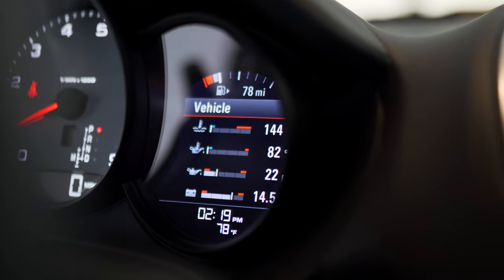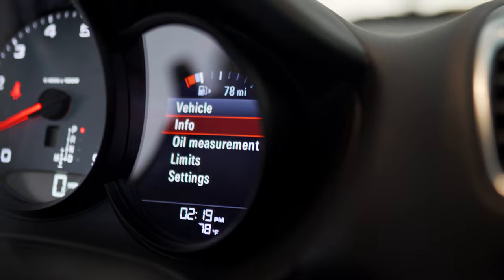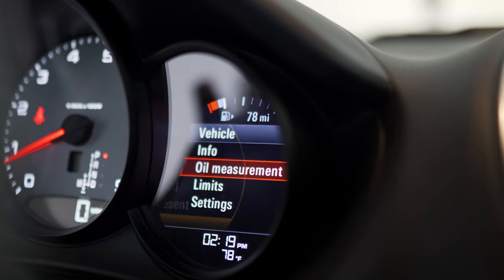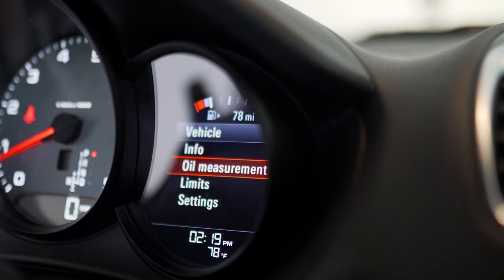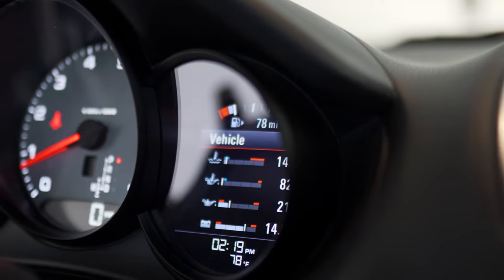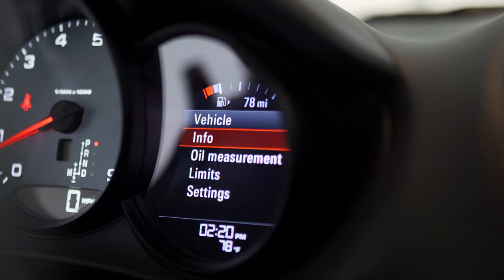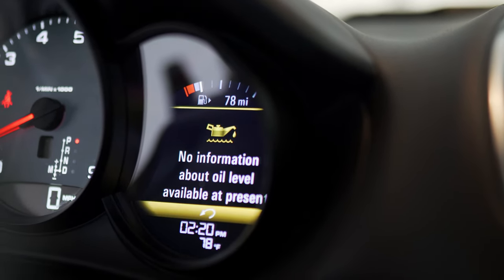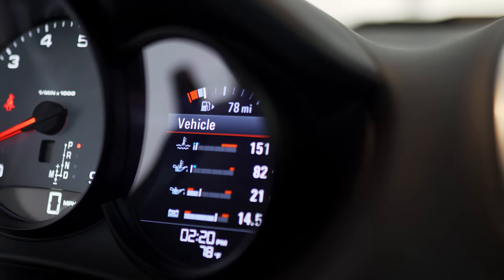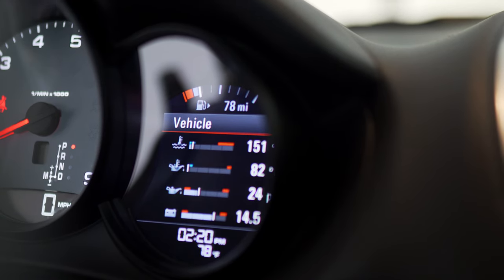Using the lever to control things in this menu, you push outwards towards the hood. And there you go — oil measurement. Nothing yet, so we cannot measure it. Let it run for a bit. The oil temperature is 82 degrees. Basically, let the car run for about 10 minutes and it should give you information about the oil measurement — it's not available now, the car is still measuring. I'd say probably when it reaches at least 110–120 degrees, then you'll have a measurement available.